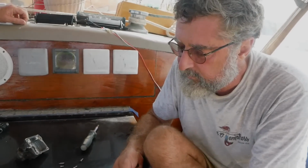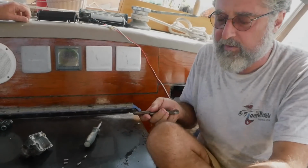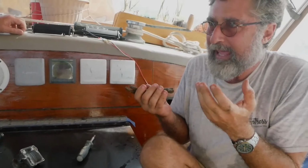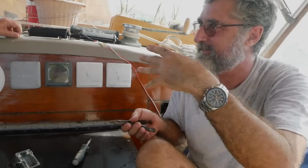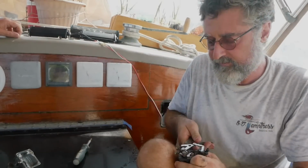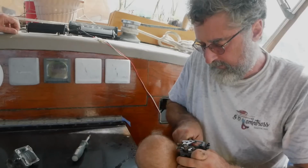That first screw that I had trouble with, that was stripped out on the bottom, held the float assembly together. Tight means nothing to that. As long as it's in, it's just keeping the float from physically falling off, and it's a flexible, floppy part. There was no reason whatsoever to tighten things so hard. Anybody that understood it.